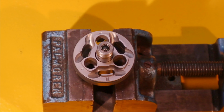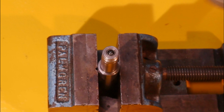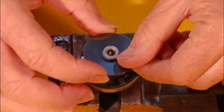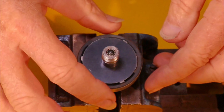and it's the only one they have. So when you put their clamping shim on this piston, it's protruding into the port. So not only aren't you getting the full flow of the port, but you're running the risk of cracking those shims because they're up in space. So here's an Ohlins piston, the 44 millimeter. It uses a 38 millimeter shim to seal on the compression side, 36 on the back side, and there's a reason for that we went through in my video on shock dyno basics.